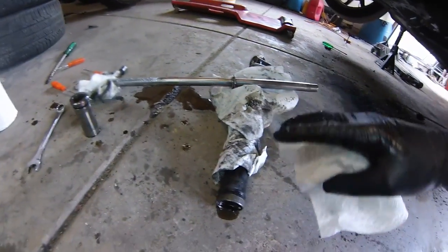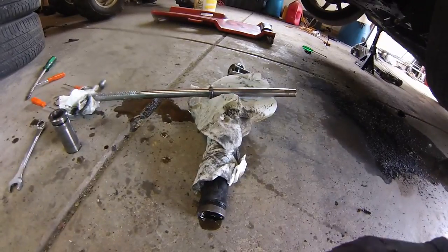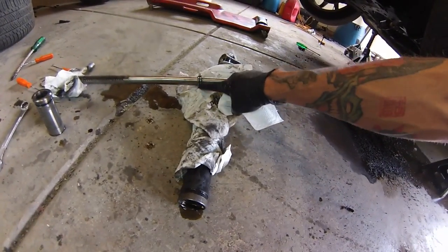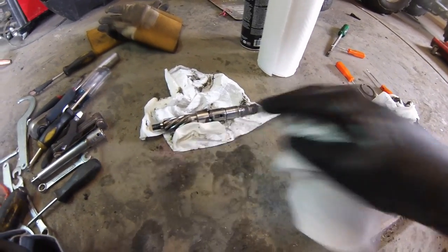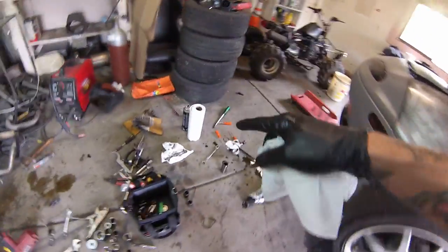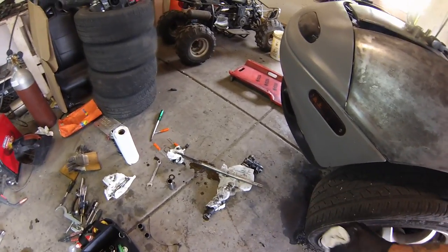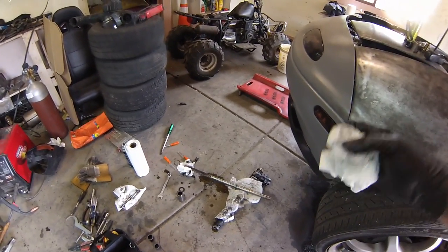I kind of skipped a few steps because there were different ways of getting this out that were not working. I had to check a couple of different forum posts and the Flying Miata PDF, but I eventually got the shaft out. I need to get this gasket off and I also welded up the input shaft so there's no play in it — apparently there's about a millimeter of play, so I put some tack welds on there. I'm not sure if I'm supposed to put the gasket set back on or not because there are bearings at the top and bottom of that shaft. I'm going by about six different forum posts. Hopefully everything goes back together and works as it's supposed to and my front end alignment doesn't need to be redone. I'm going to start reassembling everything now.